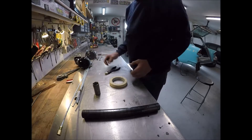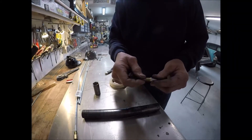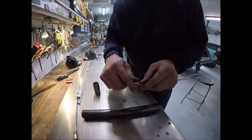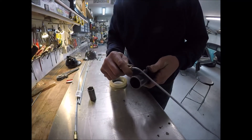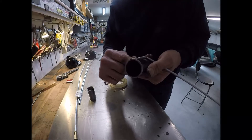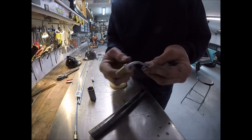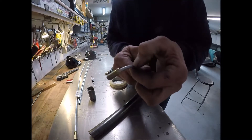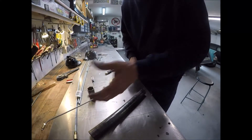Here's how I do it - give yourself a brake line. I have a small screwdriver and get on the inside of this thing, push it probably about the width of whatever nut you have on it because you can't turn it any tighter than that. Then grab whatever diameter - this is probably like 11/16ths - put your thumb on here and bend around here like this. You can actually turn it around there. What's important is don't leave this on the inside of the bend because then it won't clear the corner. You can pull off these little markings with your thumbnail or paint thinner. Nice to keep the original clean line - that's one trick.